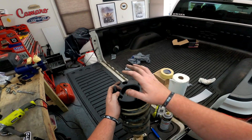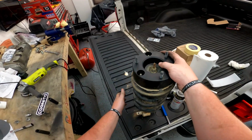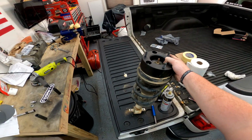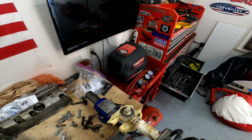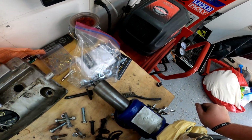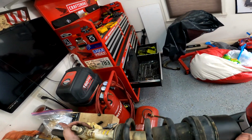Once you throw this in there, the geometry between the lower mount and the lower control arm changes. So what you have to do is you need to stick this in a vise and twist it. Let's see, if you're looking at the truck this way, and then you take it this way, and then chuck it in a vise, you need to turn this counterclockwise. This is hard if you don't go ahead and do this. This is one of the best things you can do to just help yourself out a little bit. And I mean, if you don't have a vise, then God bless you. So then you just want to take this guy and just start spinning it. And you can see that this bushing will rotate on the inside, but it takes some doing, so just be patient.